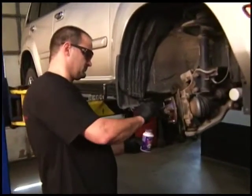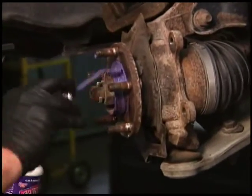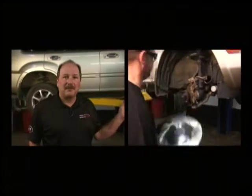Now the brake rotor is coming over, which has been washed in hot water and soap, and then of course cleaned off with brake cleaner. It is very, very important to clean off the brake rotor properly. There is a step-by-step procedure. If you do it right, you get all the metal contents out of that brake rotor. After they've built that brake rotor, there's a lot of metal shavings still stuck in it. When you use soap and water, it removes it.